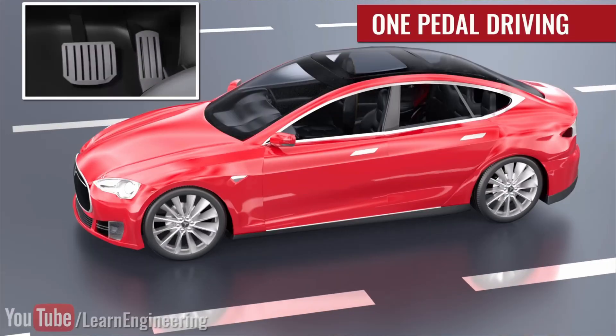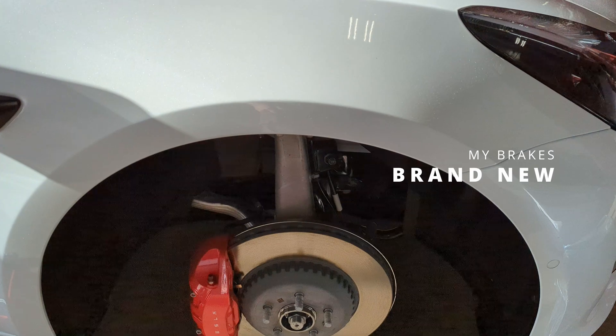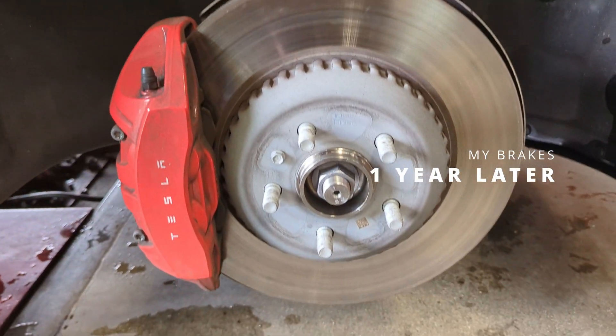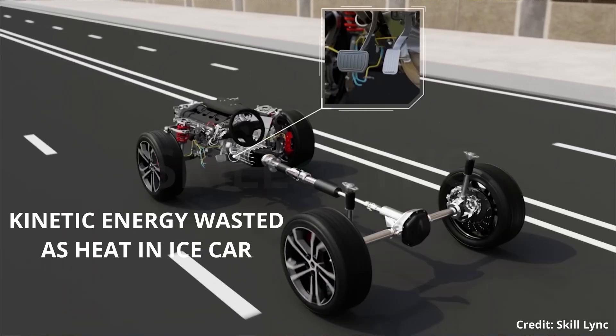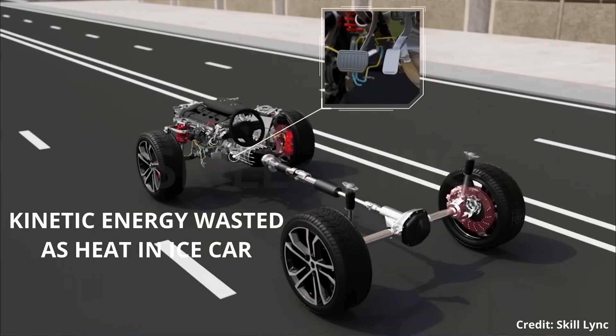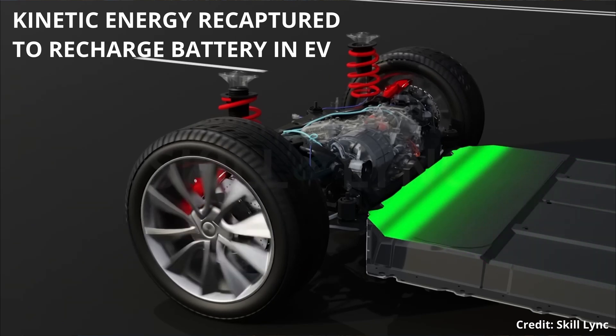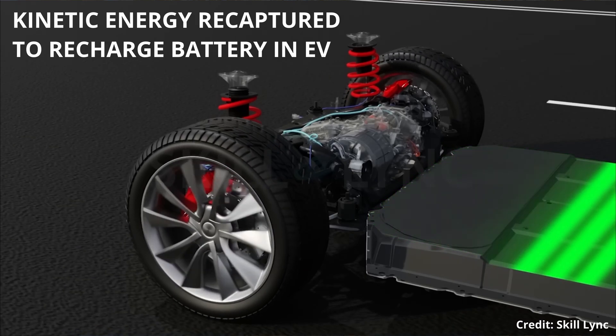What about all the downsides I mentioned? Well, if you own a Tesla, that means you have something ICE track cars don't have: one-pedal driving. I've been dailying the competition pads for a few months now without issue, thanks to regen braking. Just lift off the accelerator and let the motors bring you to a stop — no noise, no dust, and no brake wear. The only con is that they squeak when you do have to use them, but if you time your stops right, you'll almost never have to.